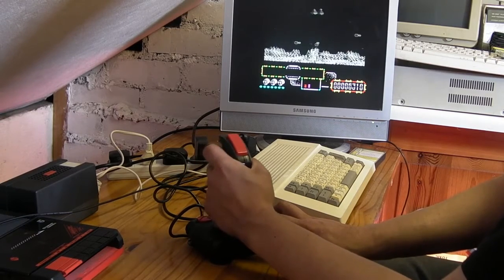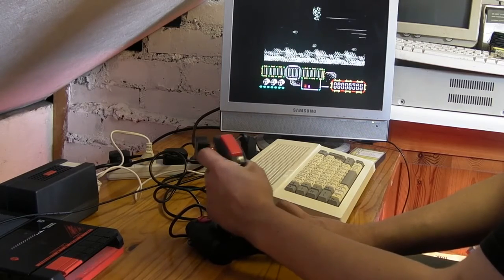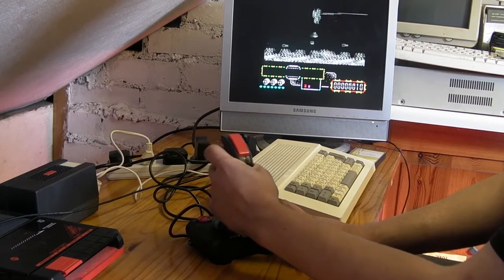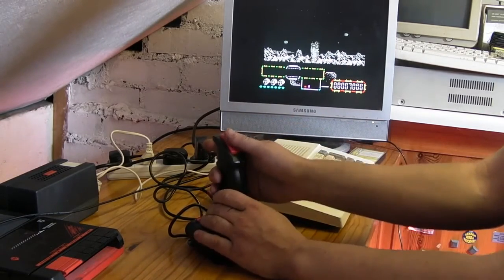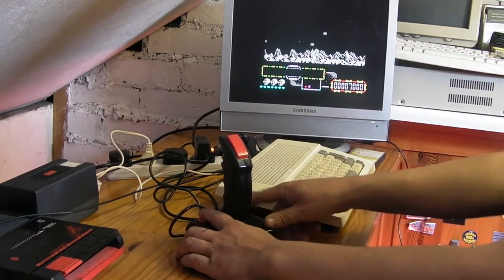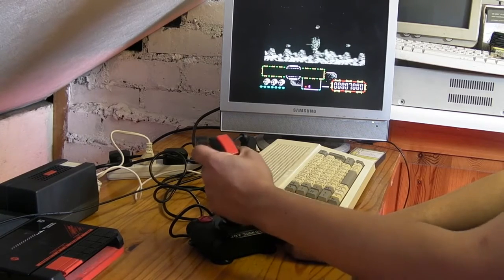It's actually slightly better than the sticks I used to buy as a kid — the £1.50, £1.35 joysticks. It's quite responsive. It's obviously not microswitched — I've not even opened it up yet, that's what we're going to do in the next part of this video. It's obviously some kind of contacts, not microswitches, but it does the job. It has two fire buttons: a top fire button which works and a trigger button which also works. The two buttons down here, as I suspected, I think are dummies — either gummed up or dummy. The joystick works as a Kempston compatible joystick.